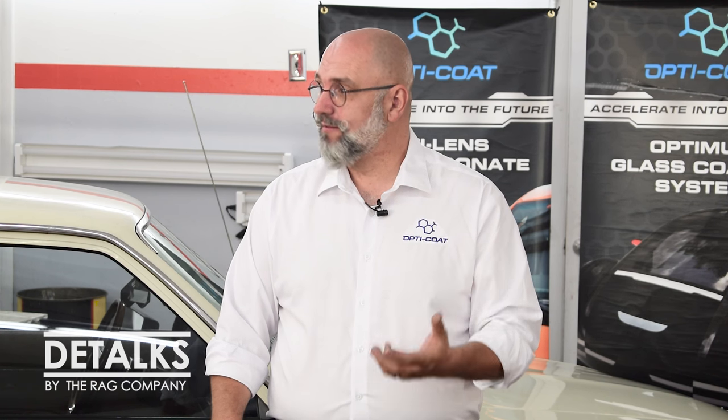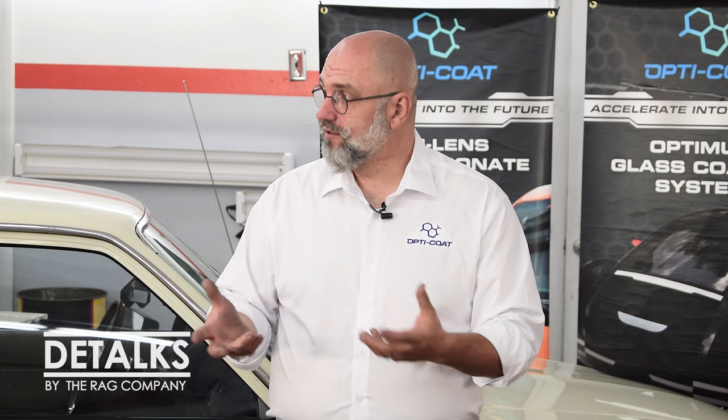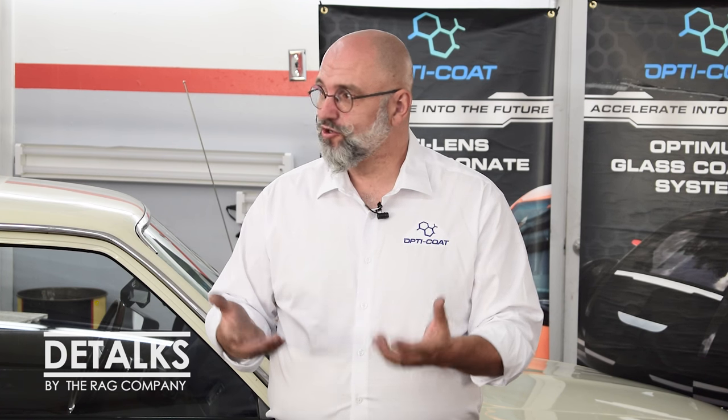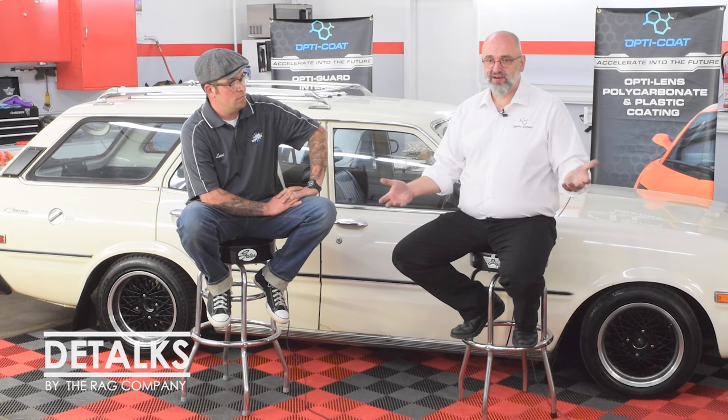Heat is very damaging to these paints. They have a heat limit of about 140 to 160 degrees. They shouldn't go over that. Now you'll say, a black car out in the sun is going to get hotter than that. Yes, it does. But the whole car gets that temperature, and there isn't something applying a rotational or vibration force to it trying to rip the paint off the car. It's just sitting there. So the paint can take it at that temperature, but not in the aspect where we're polishing, because it heats up quickly and cools down quickly as well.